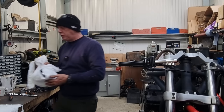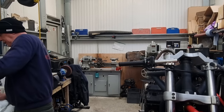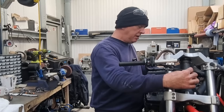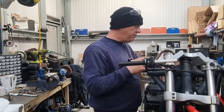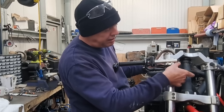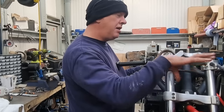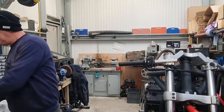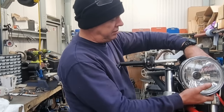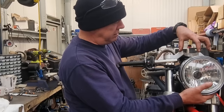Right then, we might be going for a third option, which looks a little bit like this. The reason for doing this is I've found the throttle cables, which is all good, and I've literally just got the outer sheath in place. Haven't run the cores or put ferrules on the end or anything else. With it oriented this way, essentially the cable from the switch gear comes out all together, but it's also going to go beneath the instrumentation and above and behind the headlamp. So I still need to make up these spacer tubes with the mounting brackets on. And then we've got the instrumentation to go in there as well.